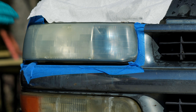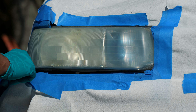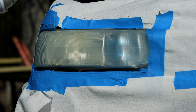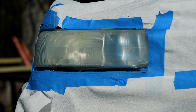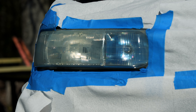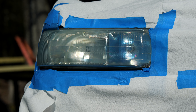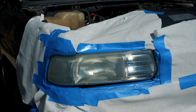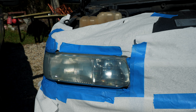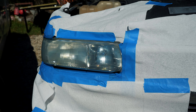While the finish is drying, we need to mask off all the areas around the lens so that overspray does not get on our finished painted surfaces. Now we're going to spray a light first coat, holding the can 10 to 16 inches away from the surface. We'll do a total of three coats at five to ten minute spacing. After the second and third coats are applied — wow, this headlight looks almost new. This repair is definitely the best we have done today. We need to let it sit for 24 hours to get the full effect on clarity so the clear coat can dry completely.